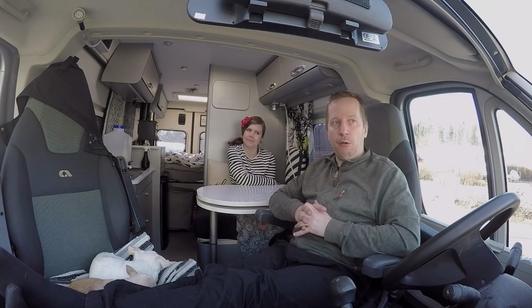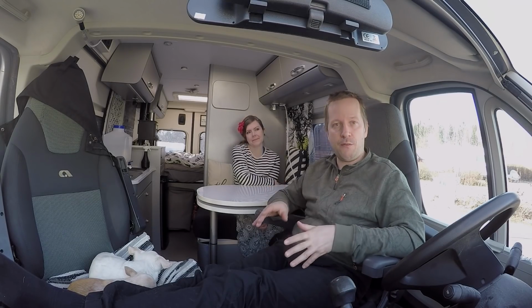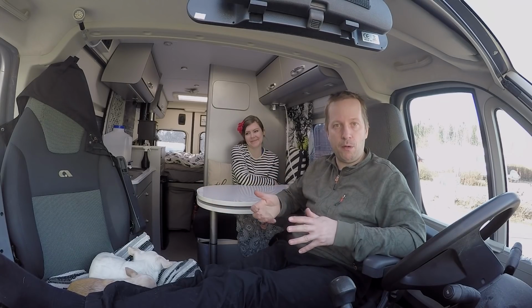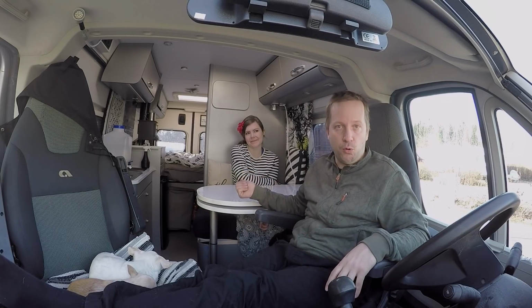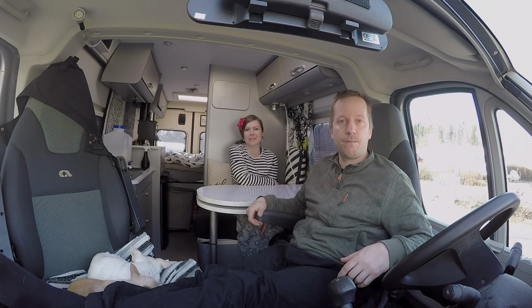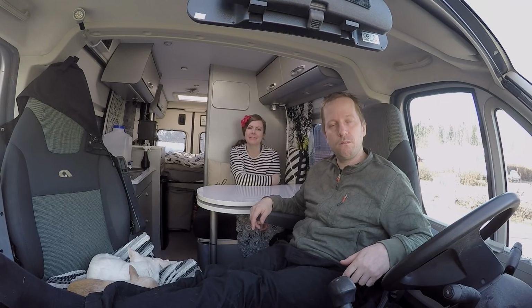And why so large a charger? We learned from the last Europe trip that all those caravan stops have these poles where you have to pay per minute or hour or anything. It's really common. So now that we have a 100 amp charger, we can charge the batteries from empty to full in 3 or 4 hours. So we don't have to stay in those boring Stellplatzes. We can just plug into the power, wait a few hours, and then start driving again.